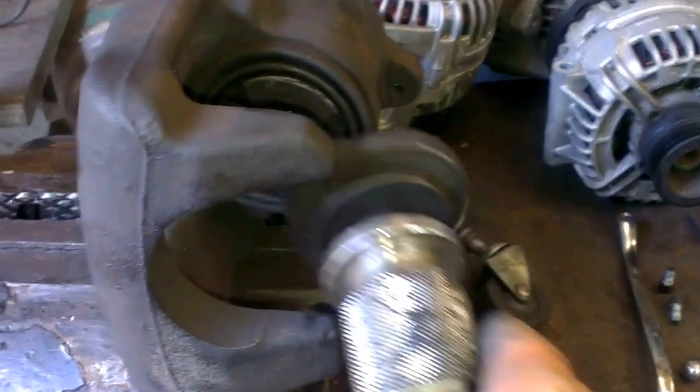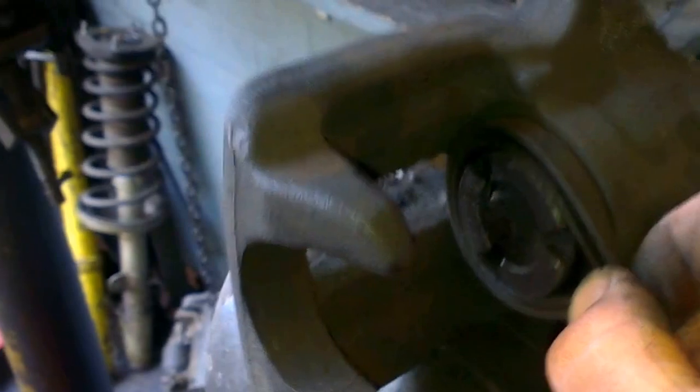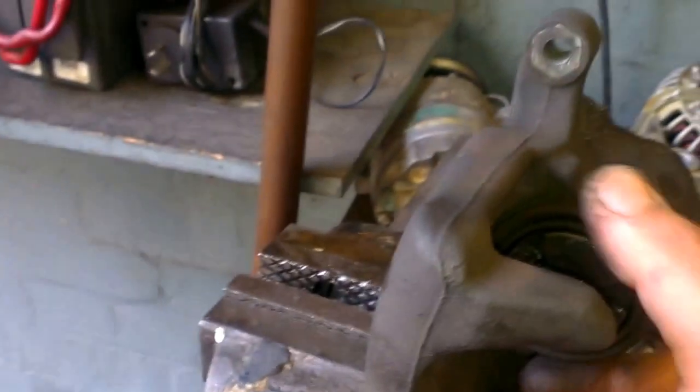Then proceed to push and twist the piston in the clockwise direction with a piston reset tool. Of course you would inject some silicone in there before you do it — if this rubber is going to turn and buckle and jam, you're going to tear it, which you do not want to do.